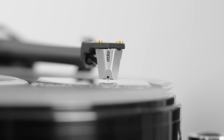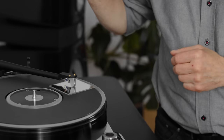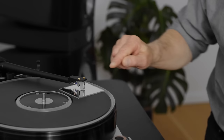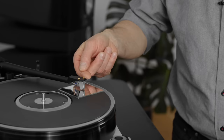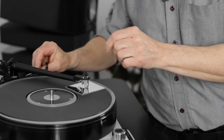If the azimuth is not correct — if it's really tilted to one side or the other — you need to adjust the mounting of the cartridge. For some tonearms there is an azimuth adjustment screw you can release and twist, but you cannot do this on the SME5. Here you would need to put a small spacer between the lower side of the headshell and the upper side of the cartridge to twist it slightly. Hopefully you don't need that. I don't need it here, but please check your azimuth.